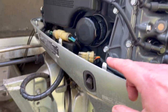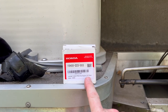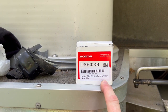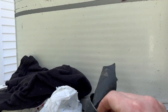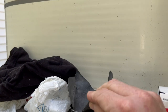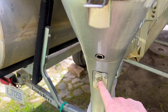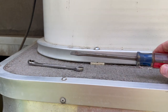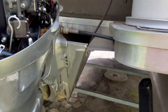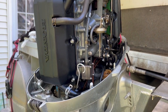Here I've got the oil filter tools — I've got the new oil filter, and I got that on Amazon. I'll put the link. Just a ratchet and an oil filter wrench, and I put the rubber on here to grab and fit it since it always slides. Down here is just a flat head and a 12 millimeter. That's all — let me get the camera set back up on the stand and I'll start draining.